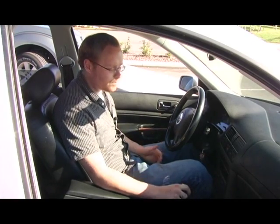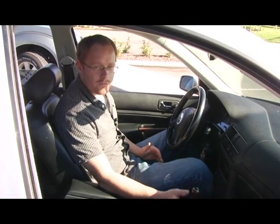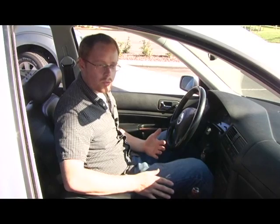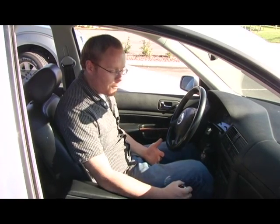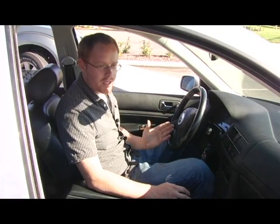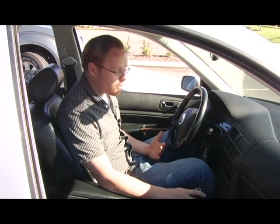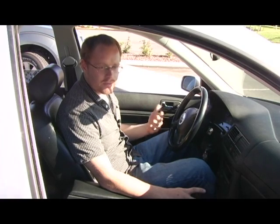Most standard transmissions only have 5 gears, although there are a few select cars out there with 6. The difference between those two is your 1-to-1 ratio, or your direct drive ratio. In a 5-speed, fourth gear is always direct drive, meaning that the engine is spinning as fast as the transmission is spinning. In fifth gear, it actually is an overdrive. Overdrive meaning that the engine is actually spinning slower than the transmission is spinning.